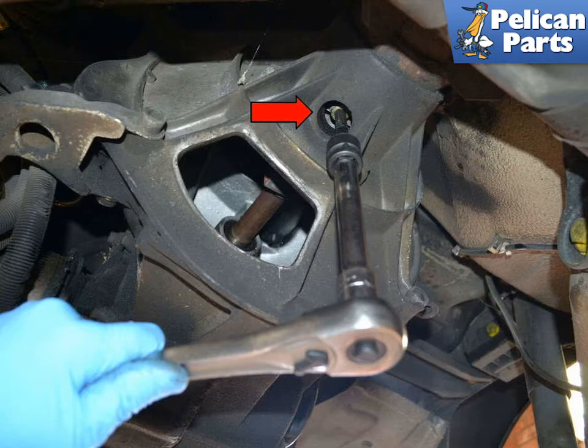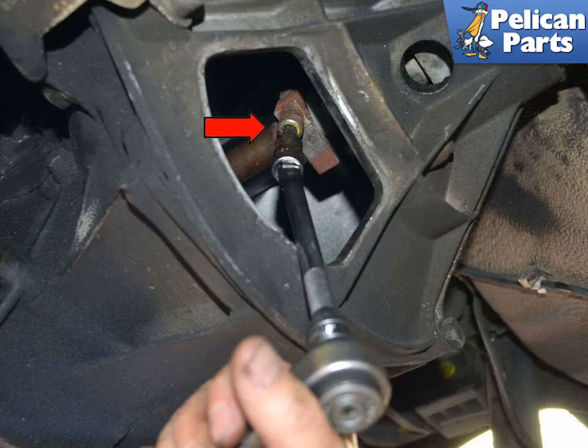You can use a 24mm wrench and turn the main crankshaft bolt, if the car is in gear, to turn the torque shaft. Rotate the torque shaft until you can get access to the 8mm allen bolt on the rear of the coupler. You will need a wobbler or a universal joint to get a good fit in the allen bolt. You also need to completely remove the bolt as it sits in a groove in the spline — you will not be able to slide the coupler off the shaft with the bolt in place.